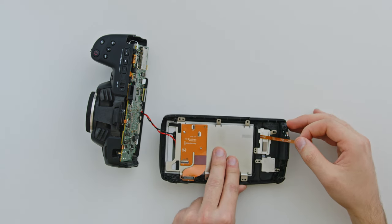Now we can reassemble the camera. Without tugging on the power cable at all, align the two halves but leave a small gap. We need this gap so we can plug this connector back in. Use the flat end of the plastic spudger, move our display ribbon cable out of the way without pulling on it, and gently press the connector into place. This connector can sometimes be difficult to align — you may need an even smaller gap between the two halves, which will bring the connection closer. This is another step that will require patience — please do not force this connector, as it is delicate and does not require a lot of pressure. Once it is connected, press the back of the camera all the way into place, pressing in the area where the connector is to keep it securely in place.